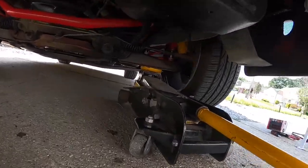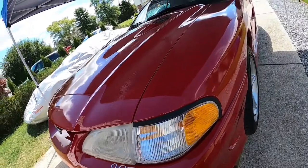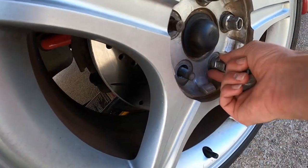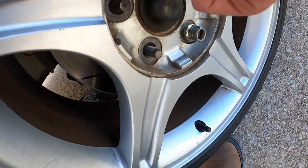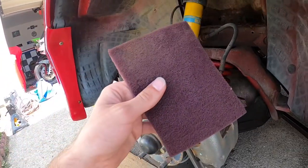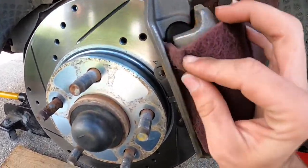I have it sitting on the little donut that's underneath the A-arm. Before that I loosened up the lug nuts so they're hand loose — you just want to spin these off and take off your rim to get to the caliper. I've already started to do this, but for my calipers, being that they started to rust, I'm taking a red Scotch-Brite pad — you can get those from any hardware store — and I'm just sanding it back and forth.